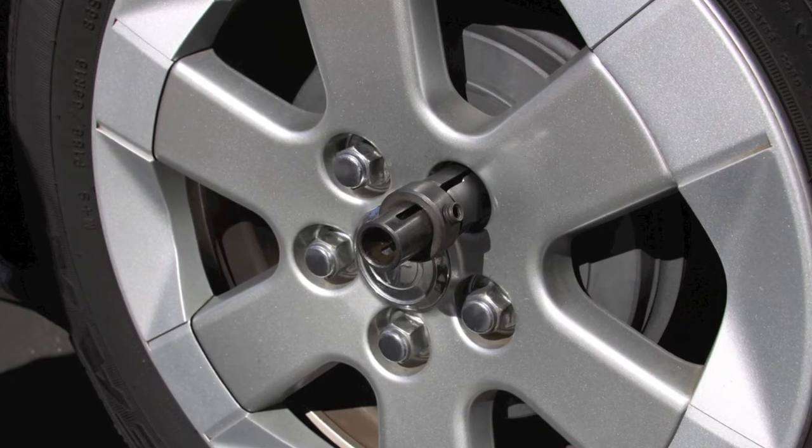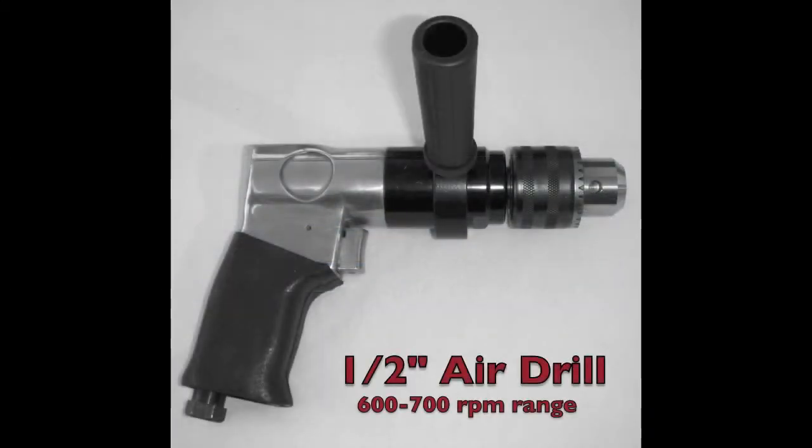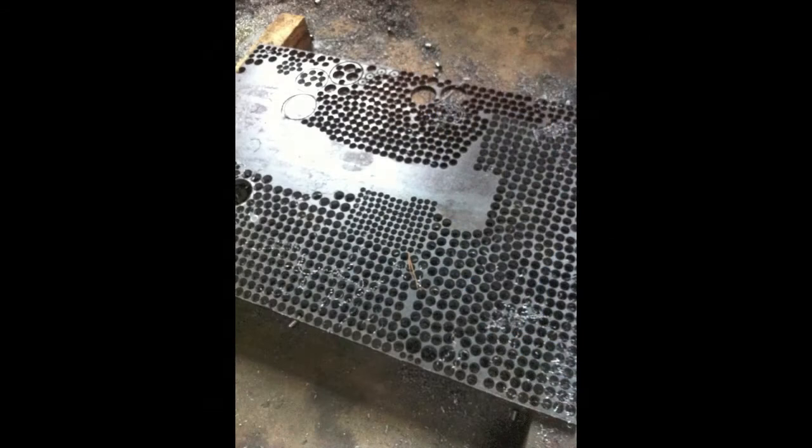It's very simple — just slide the guide over the lug nut and secure it down with a collar clamp. We have a six-inch tungsten carbide steel cutting drill bit. The drill of choice is a half-inch chuck at low RPM, 600 to 700 RPM. An air drill seems to be the preferred option. We did our research when we went to the manufacturer and asked if this drill bit was strong, and they gave us a thumbs up.